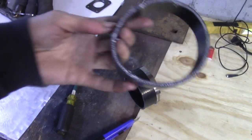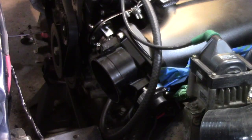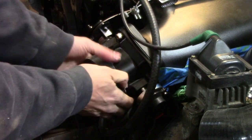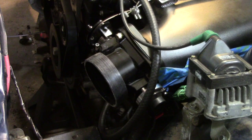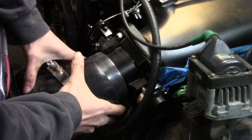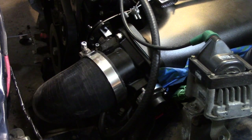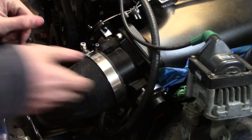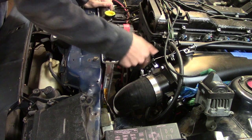Got this little spacer here. I'll go ahead and throw this on the throttle body and clamp the 90 on to make sure it fits. The spacer goes right here — I'll put the factory cut side showing, looks nicer. This should go over this with a little bit of effort. That's on there, so we'll tighten this clamp up. Actually, I have to leave it loose for now so we can rotate it. That looks good right there, I don't think it's going to be coming off. That's with the radiator in — as you can see, it clears.